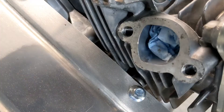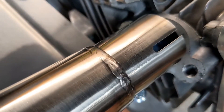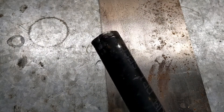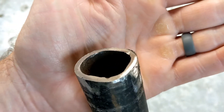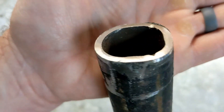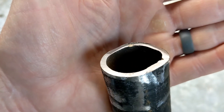I've got one sitting right there, so I've got to figure some way to fit this to my motor. So I decided to make an exhaust manifold. I got some 3/16th sheet steel and one of my favorite crafting items — water pipe, schedule 40, just a one-inch steel seamed pipe. Of course pipe is round, so I cold-worked this pipe a little bit to create a D-shape in it and get a better profile to match the exhaust port.